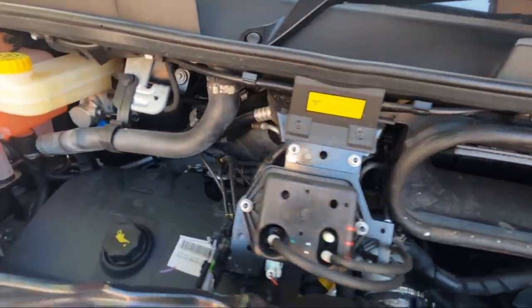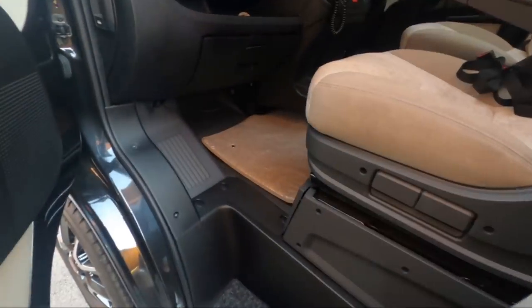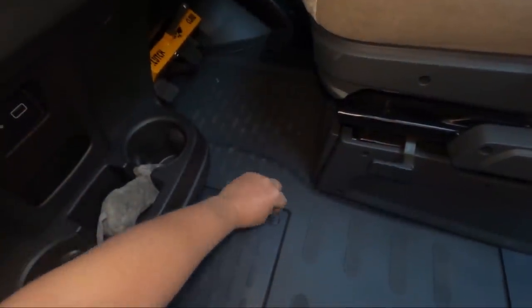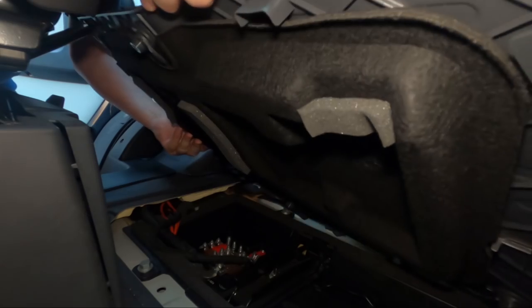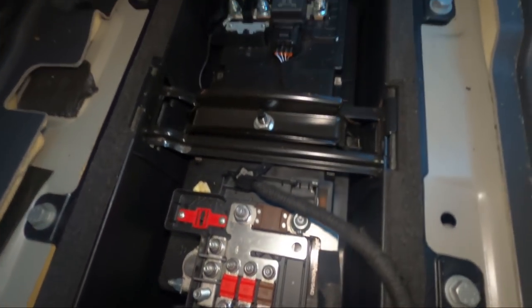One thing you might notice about this engine bay is there doesn't appear to be a battery. So where is the battery? Now on this model you'll find the battery under the passenger side footwell. Having moved the carpet out of the way and get to this panel, it involves undoing that clip there, and you'll need a coin or something. Pound coin works really well. That one there. That's it. You can take the panel out now. And that's the vehicle battery. So you can see it's quite a beast.